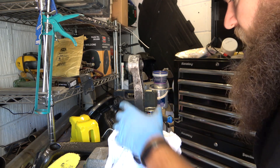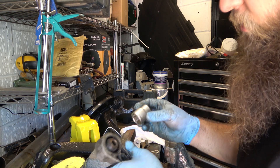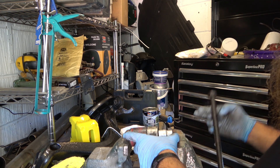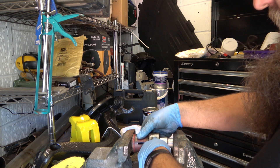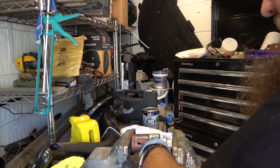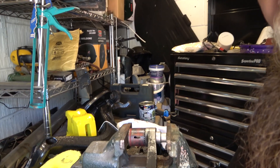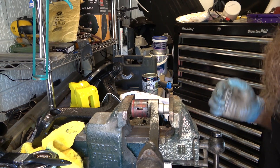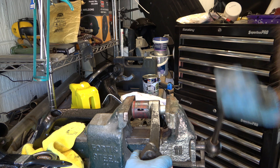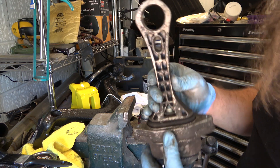The hole saw isn't ideal because of its serrated edge, but since you're not spinning it, it won't damage the face much — just a tiny mark — and you'll be repainting anyway. I've sanded the sharp edges off to minimise damage. This is why you need a vice. Get it wide, try to get it centered, and just wind it in. The first few turns will be quite hard and then you'll hear it crack and it will start to pop. Just wind it through until it falls out.